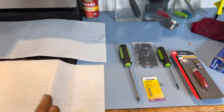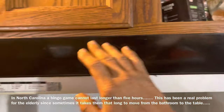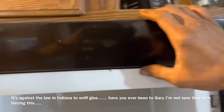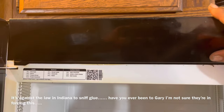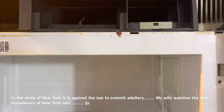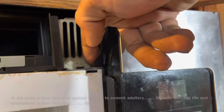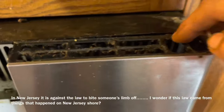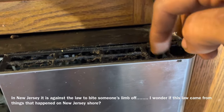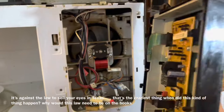The first thing on just about any microwave is we're going to need to remove this cover. On my particular microwave there were three screws along the top and one screw down the edge. On every microwave I've seen you usually move the cover to the left once you get the screws out, then you should be able to remove it rather easily. The next thing on my unit is there was a screw holding this down here, and up in the top of the greasy vent — if you take a light and look down inside there — you'll find a screw as well, and that allows you to lift up and remove the control panel.